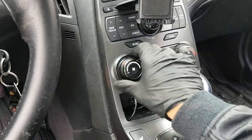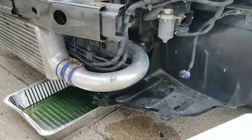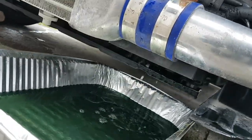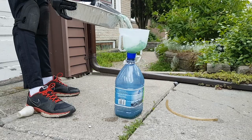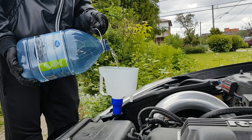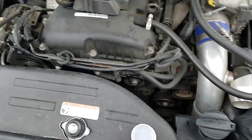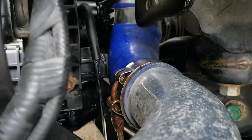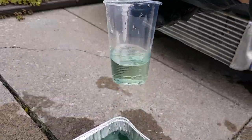I let it idle for 10 minutes, now I'm just going to turn off my heat and the engine, and let the engine cool down. This time I didn't raise the car up — I decided to just lower it and take off the bumper. We're just letting the distilled water drain out. Here's the result from the first flush and it's a lot more green than our original. This entire container is 4 liters — about a gallon. Here we go with our second flush. Sometimes the system may back up a little bit — all you do is grab your upper radiator hose and squeeze it. Turns out you don't have to unscrew the petcock all the way, just a tiny little bit and the drain pipe will just do its thing. I think we're good — this is almost crystal clear.